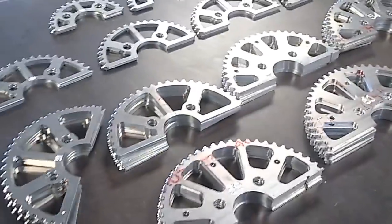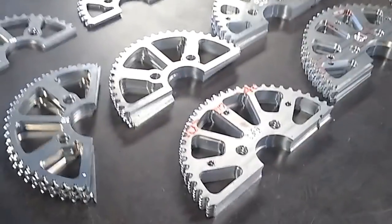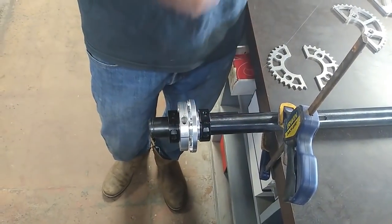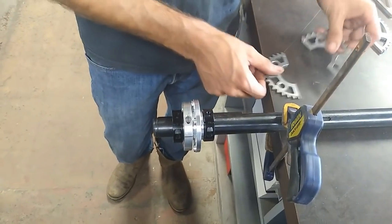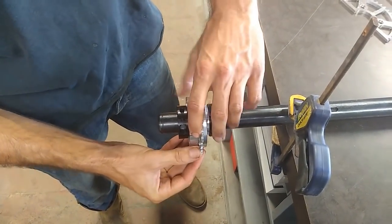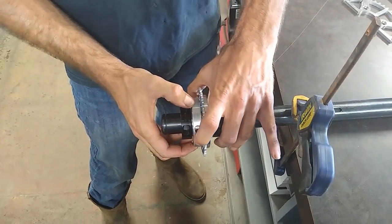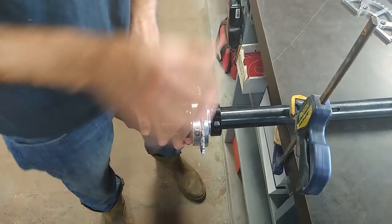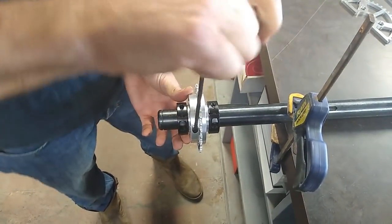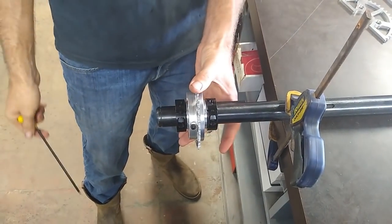We do make 69 gears for junior classes that are on gear rules, but that's not part of this master assembly. I'll switch over in just a second and show you guys how this thing works. So looking at the hub assembly here, we can do something as easy as put a 33 gear on it — it slides on, this sleeve slides back over, and then with one simple bolt you lock the gear in place. Now that gear is in position and ready to go.